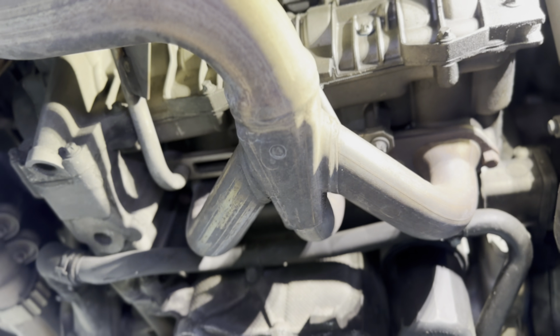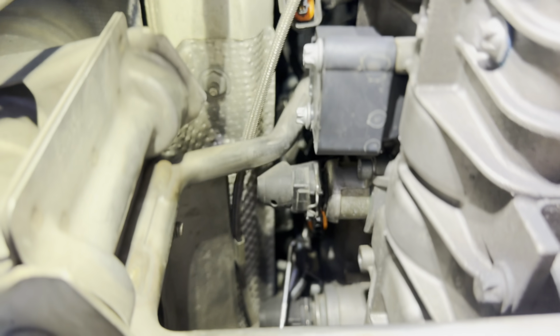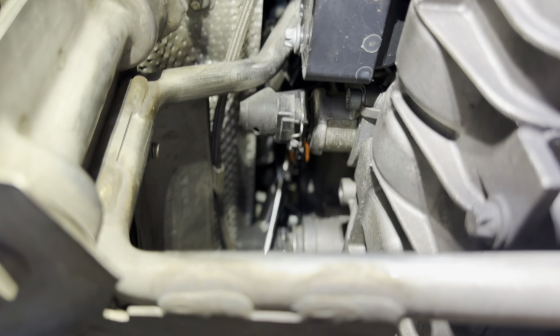I want to show you guys something real quick. So for this coil, that is going to be cylinder 4, which is the one that's way down there. What I do, to get that connector off, you see that connector over there? I go in there through here, and then I use a pick to, let's see if it focuses, I use a pick to get that connector off.